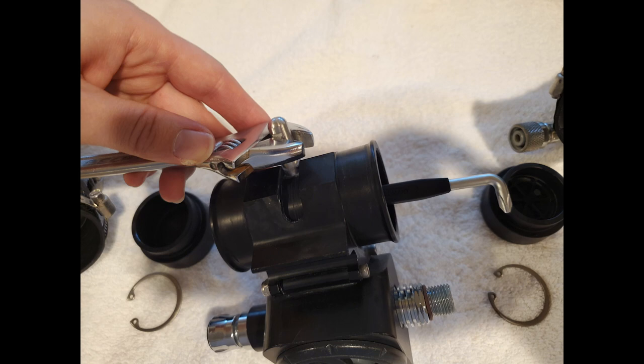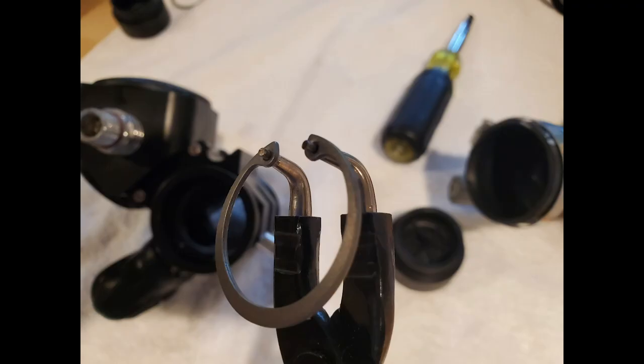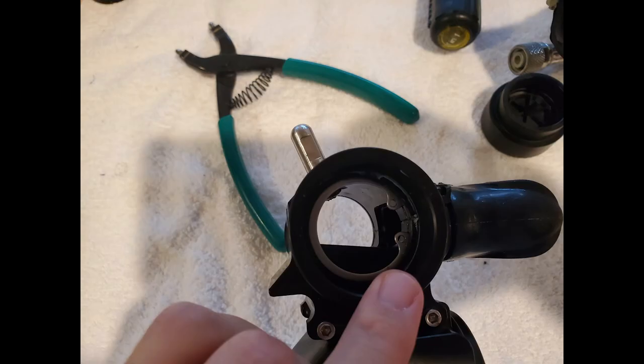You will need your adjustable wrench and your right-angle screwdriver to tighten that back down. After that is tightened, grab those snap ring pliers — make sure the flat edge is going on to the inside of the BOV. Gently squeeze them together; there's a groove it will snap into. Make sure the opening on the snap ring is aligned with the crack in the barrel.